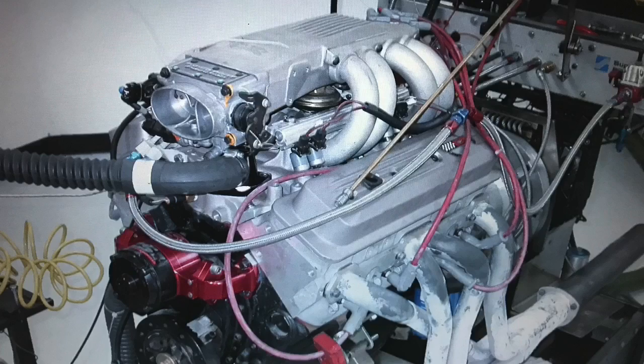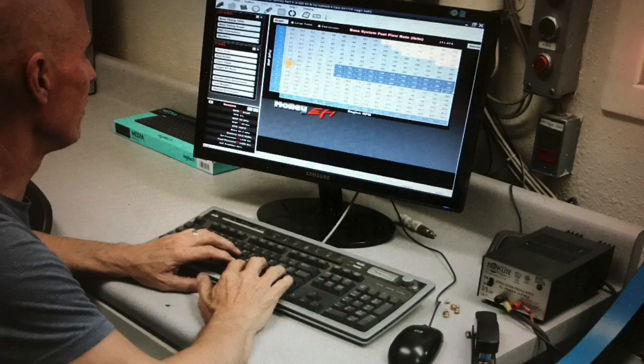The other thing to think about in terms of the power output on our motor on this dyno is we test differently than the factory does. The reason this motor had a 245 horsepower rating from the factory and a different power output on our dyno is not a case of happy dynos — all it is is the way that they test. When the factory tests a motor, they test with everything installed on the motor the way that it is in the car. They're testing at the flywheel, but they have everything hooked up — full exhaust including the stock exhaust manifolds, cats, exhaust all the way out to the tailpipes. They also have full accessories, everything on the motor running, plus the full air intake system with filter, mass air, everything. And then they run the motor with a fairly conservative factory tune. We know there's always more power to be had from tuning, because everyone in the business of doing chips or tuners knows they have conservative air-fuel and timing values from the factory.